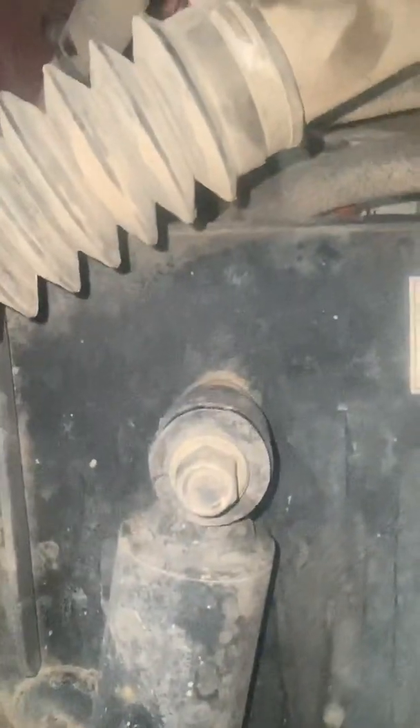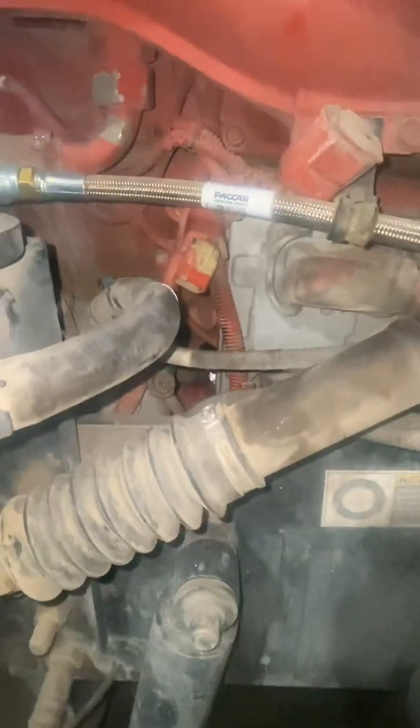The location of the actual sensor is in a very, very messed up place. There it is — it's right inside of the block. You got the RCM right there, power steering pump right there. It's basically where the shock is. This is the Peterbilt 365. It's right back there. Pretty easy to locate, but it's just a real pain in the butt to get to.